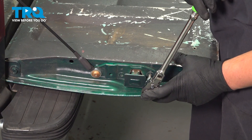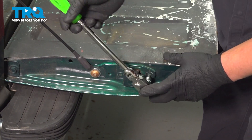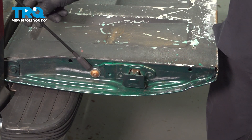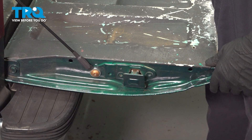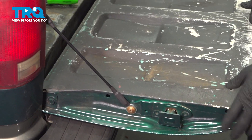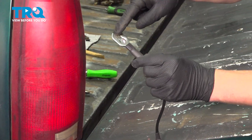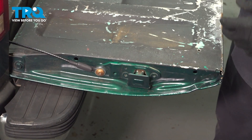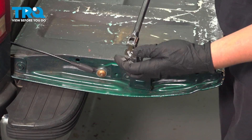Repeat the same process on the other side. Since this cable is tighter than the passenger side one, we're going to lift up the tailgate and disconnect it from the bolt. Push it straight up into the eyelet and then pull it off. Our other tailgate cable will hold the tailgate and we won't have pressure pulling on this bolt as we pull it out.